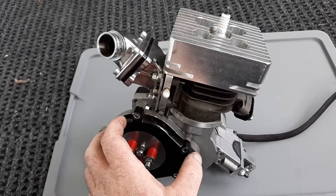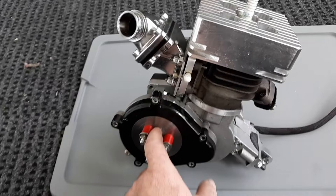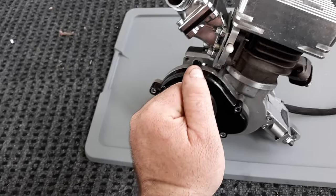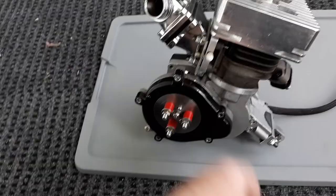I rode this 450 miles, then I had the rear bearings go. Probably 100 miles after that, I had to replace the pinion because all the teeth just disappear. These are not designed to take that kind of force — the bottom halves of these little China dolls.